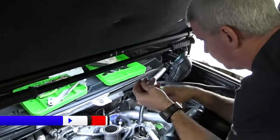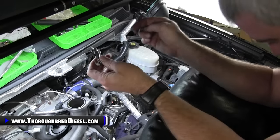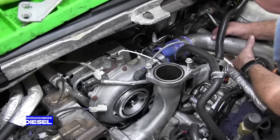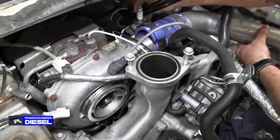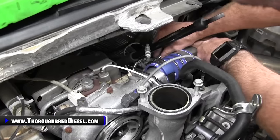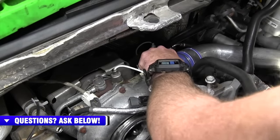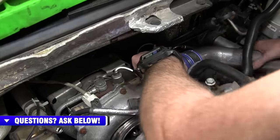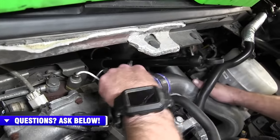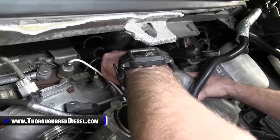We're gonna go back and we're gonna button up a couple things on the driver's side of the truck. Your fuel line safety clips, you wanna make sure that you reinstall those. I was looking at that as we were going forward here, getting ready to do the intercooler pipe. But you wanna go ahead and get these safety clips on the lines. They came off just the way they came on. Little hook here, or end goes in the female end of it. And then we wanna go ahead and make sure that we get our intercooler piping on, as you're pretty much done on this side of the truck as far as everything will need to be done with the intercooler. So we'll go ahead and put it on and have your 11 metric ready to tighten it up.